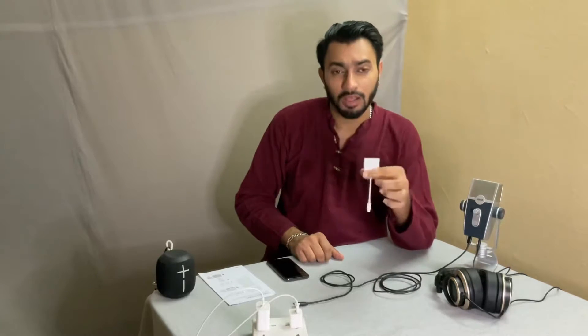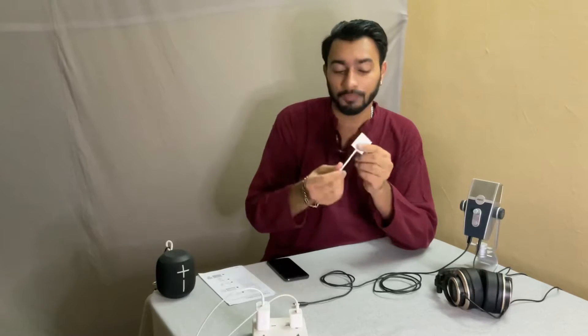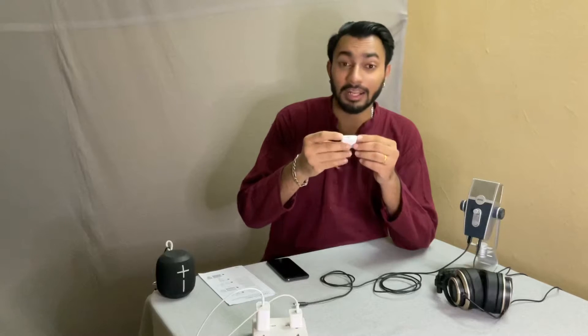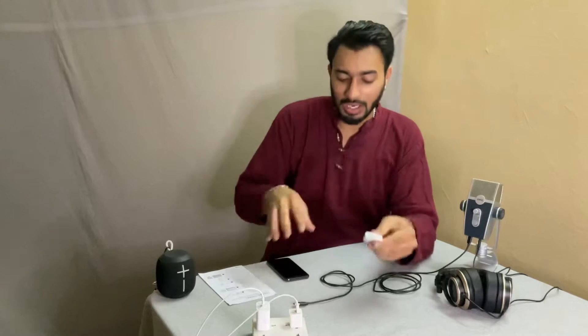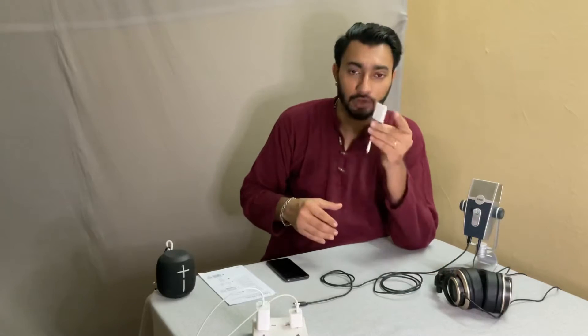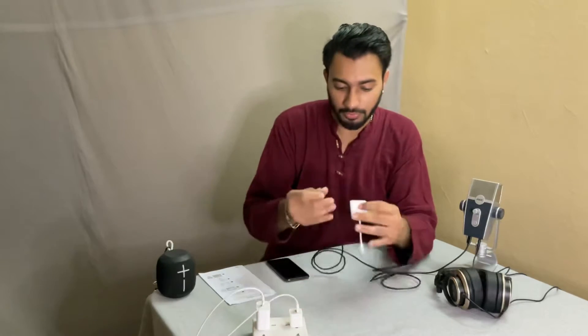For iOS mobile devices, you need an Apple Camera Adapter — this one here. It has a Lightning pin that connects to a regular USB port, and also a Lightning port. iOS devices are not designed to power a microphone like this, so you are supposed to plug in a power source via another Lightning cable to power the microphone.